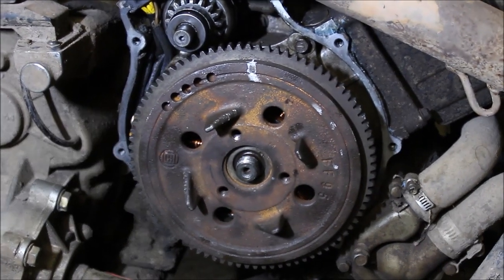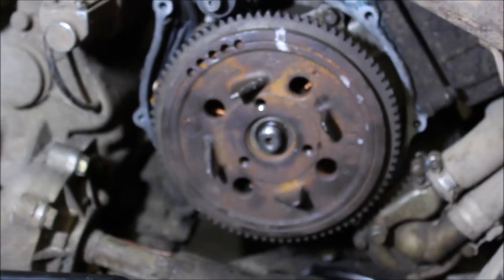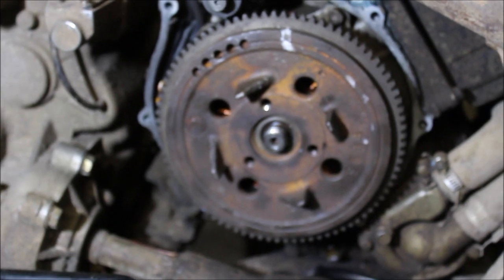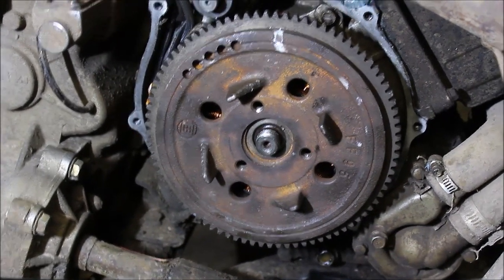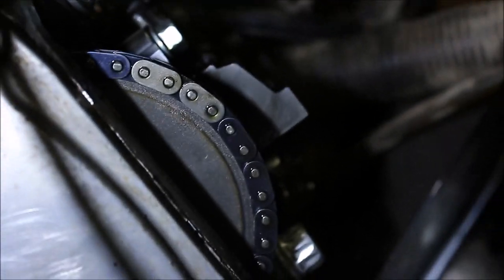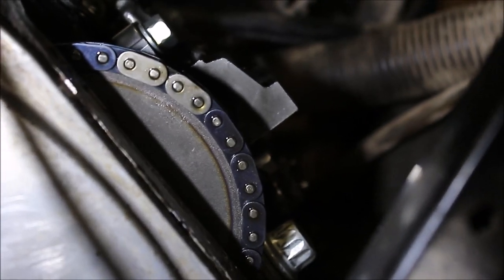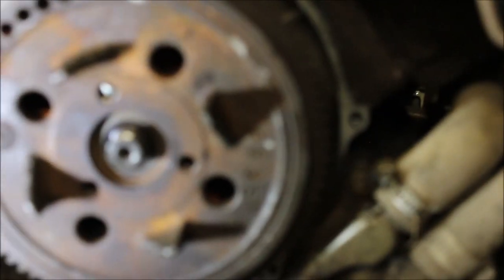I was going to show you how she fires up, but I started it up and it idled for a couple seconds and then nothing. I've been going through my carbs thinking maybe I'm getting too much gas — I saw some gas coming out of the carb. That got me thinking, let me double-check the timing. I can see the T for top dead center, but now looking at my cam gear, the two divots aren't on top like they should be.